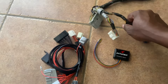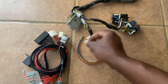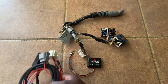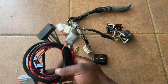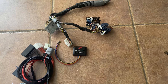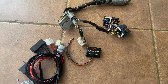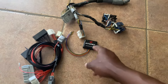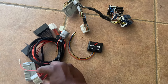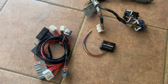From the stock car we're going to take all our de-pinned E-plug wires for all the EVAP, and we're also going to install a secondary O2 sensor as well. The original harness only comes with the primary, so we'll be doing a secondary as well. Then we'll get all the EVAP wired up and ready to go, and after a couple other things we should be able to start the car.